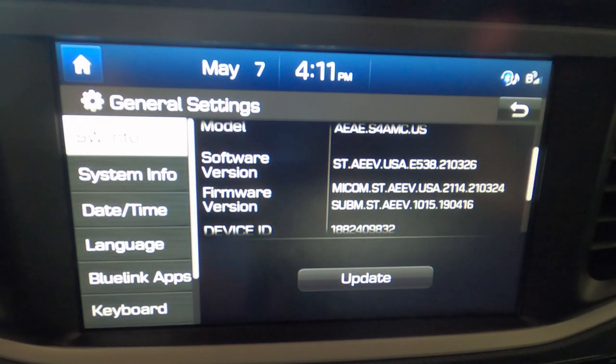There you go — it has now been updated and we are back on the main screen of the radio. If you want to verify the update went through smoothly, go back to All Menus > Setup > scroll to the bottom > General, and right there you will see your versions to confirm they are up to date. As of May 2021, we have 21-03-26. Keep in mind this is for the Hyundai Ioniq EV, so your versions may vary slightly depending on which Hyundai you're driving. I sure hope this helped — hit that thumbs up, please subscribe, check out techmotoring.com, and we'll see you on the next episode.